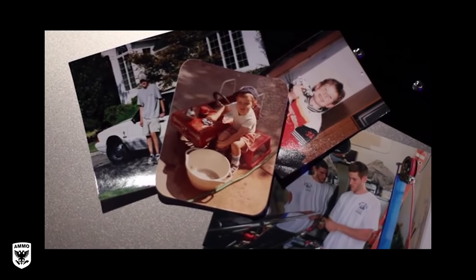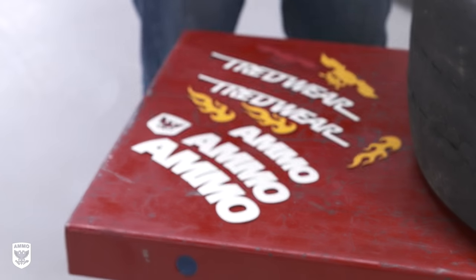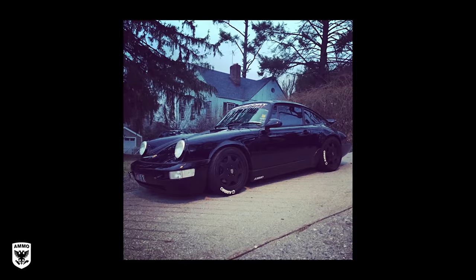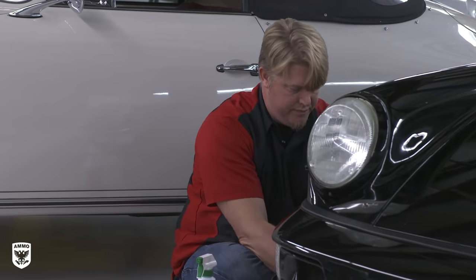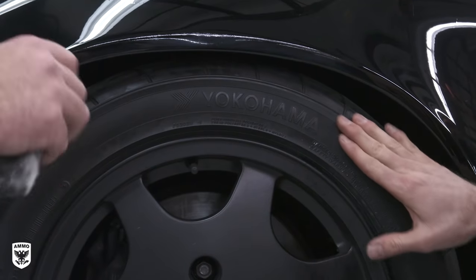I was hooked the minute I saw them. Based on the emails I received once I posted Instagram pictures of my wheels, it seems everyone wanted to know the steps for installation. And it is a lot easier than I thought. The key to our product working well on the tire is preparation — surface preparation, you've got to have it down. Especially if you've used a tire dressing. You've got to get that off; you cannot have that on there, otherwise it's going to fail. You need to get a rubber-to-rubber bond.